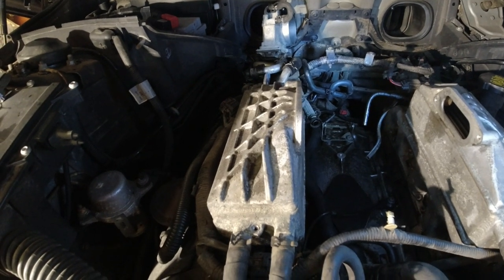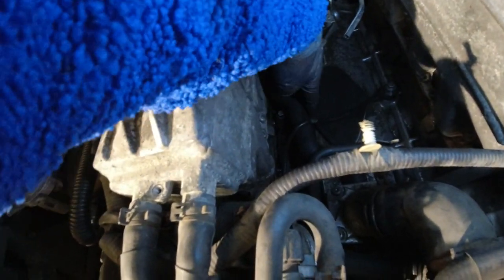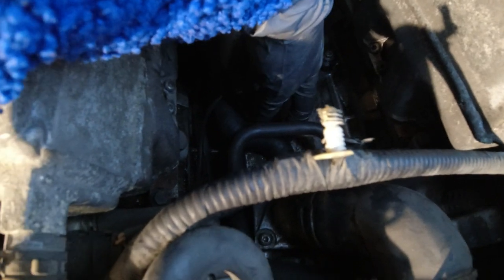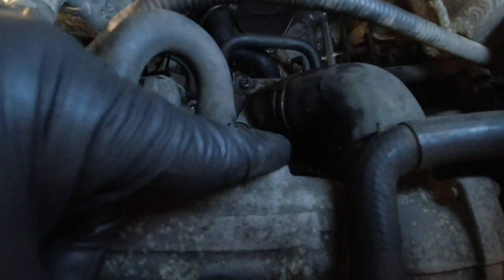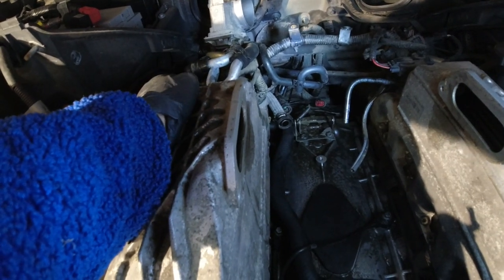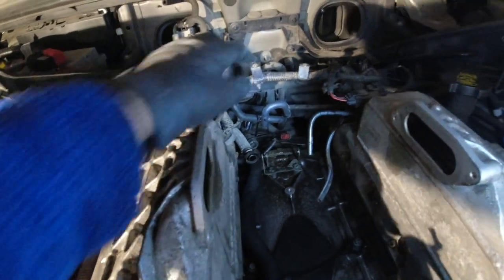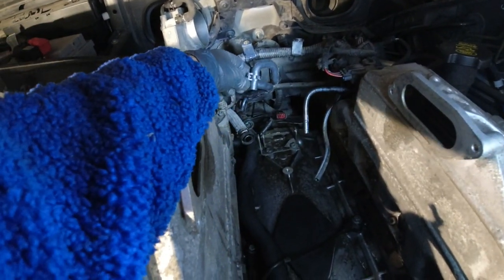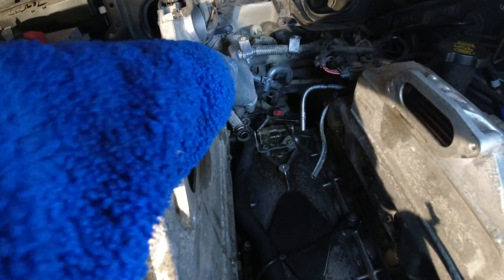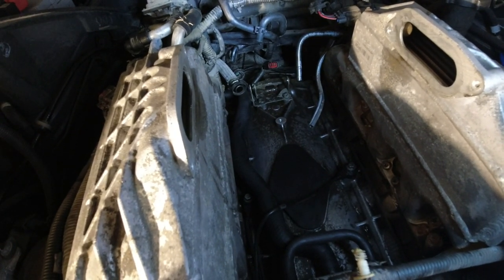So this was quite fiddly, but that new hose is in place. There are two of them down here. One goes in there, and the other one goes up here, and that's where we had the leak. Then they snake around this engine loom back here, and they're part of this bracket that screws into place, and then the heater hoses here just click on. Then you have these two hoses here, which are going to go to the throttle body, but I'm going to put them on a little bit later. Everything is really buttoned up back here, and I'm getting ready to put the supercharger back on.